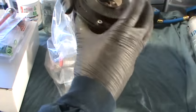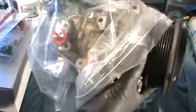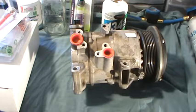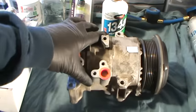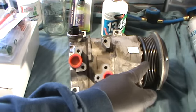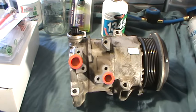Somebody was asking about the clutch. This is like the Sandin — actually, this is a Denso, but I guess the original Sandin is what they call them. They have pistons inside here and it doesn't use a clutch; it uses a plate that flexes. I'll leave a link in the description to how it works. On a clutch system, the wires go to the front and you have a coil that activates the clutch. This doesn't work like that. Inside here you have this plate that rotates.